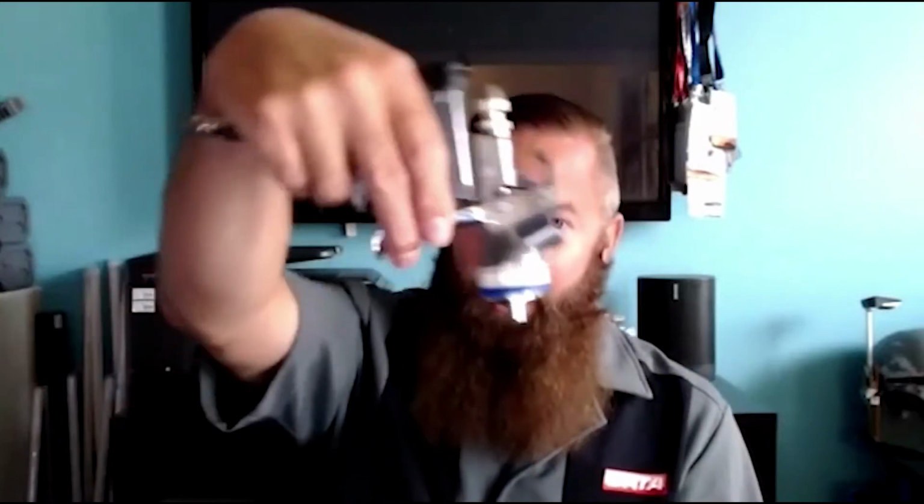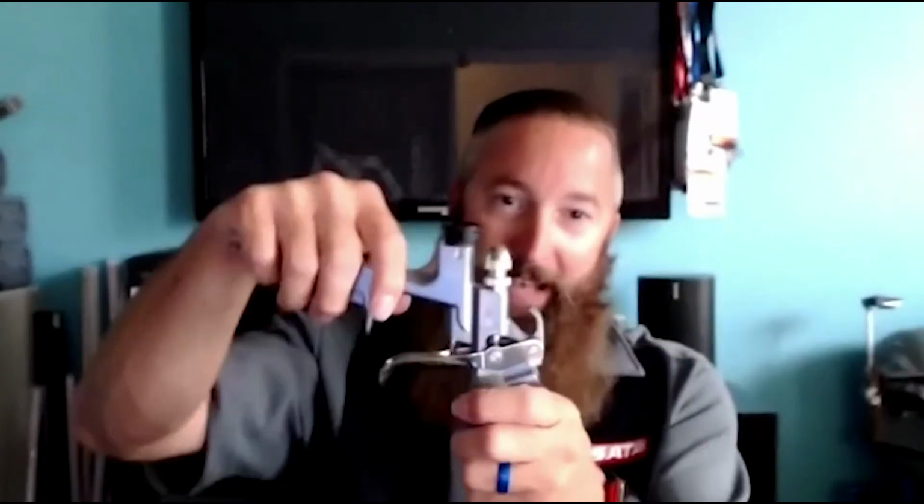Yeah. Not only is your transfer efficiency hugely increased, but just the function of that cup, siphoning the material up a straw. A lot of people, when you tip over the gun, you would always paint your hoods and roofs and deck lids first with the fear. Usually there was a rag wrapped around the cup, because there was the fear of, I've got a full cup and I need to tip it to spray that hood, but now I'm worried about a drip. But if I spray my verticals first, I've used a portion of that cup, and it's kind of like taking a drink out of a cup with a straw, right? That straw is tipped to one side, and then you start sputtering.